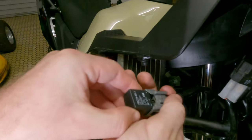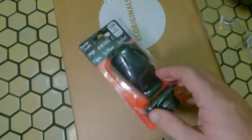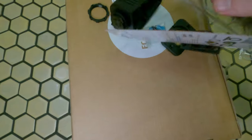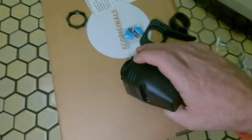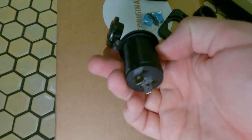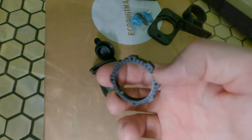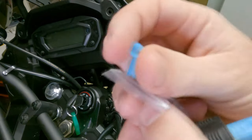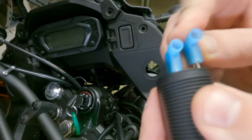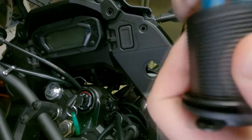While we're here I'll just plug this relay in — really easy to do. Done. Now I'll show you the cigarette power socket I bought — your 12-volt marine grade socket. Open it up. You don't need any of the outer housing, it comes like this nowadays. All we need is this cigarette lighter socket and this bit here which locks it on and tightens it to the back of the fairing. It also comes with right-angle terminals which is fantastic. Positive and negative — they are rock solid; I was worried I might have to solder but they're not going anywhere.